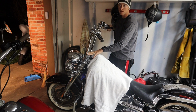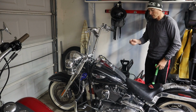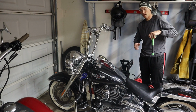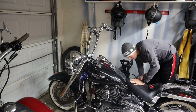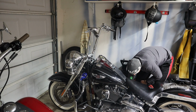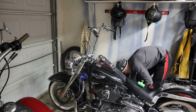So, yeah. Alright, so next we're going to replace the clutch cable. What you can't see over here on this side is I'm on the transmission cover. Backed them all out. I had to remove the exhaust mounts to the frame. Pull the exhaust out, lift it up, get the screws out, sorry. It's a little persuasion to get this unsealed. Oil is going to come out, so just make sure you grab it.